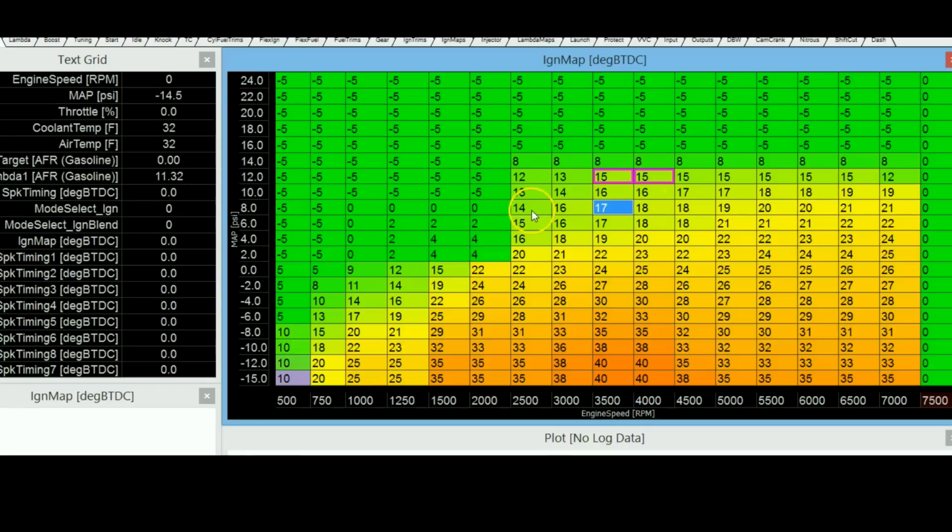What you see on the torque output is, let's say the torque is going like this. Either at this value, when the engine gets to this RPM, the torque is going to go up or the torque is going to go down. If the torque is going down, that definitely means you're going in the wrong direction. You should be going back down. But if the torque keeps climbing up, that means you're still going in the right direction. Then I'll keep incrementing it until I get to a certain point where the torque starts saturating,